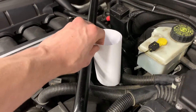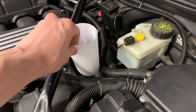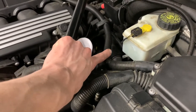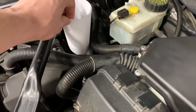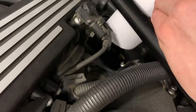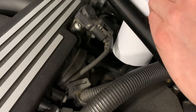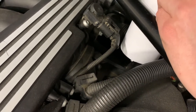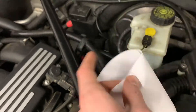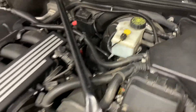The first location is where most people would put it on three-series vehicles — right at the back of the intake manifold, in front of where the cowling would be. You can see it fits pretty well here, but one downside is it would be rubbing on the ignition wiring loom. The other problem is that serviceability would be really difficult — there isn't enough room to remove the bottom portion to empty it. So this location is pretty much a no-go.